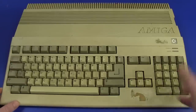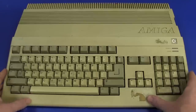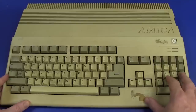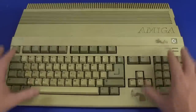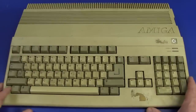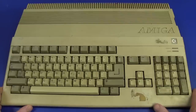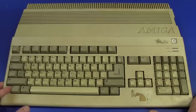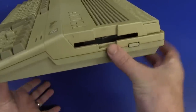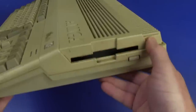Many millions of these sold — 512k of RAM, which was pretty huge back then. This is almost a follow-up to the Commodore 64, although there was an Amiga 1000 a couple of years before this. But that was a big box type, whereas this all-in-one keyboard unit is very reminiscent of the Commodore 64, so it is a bit of a successor in that respect. 68000 processor — very common back in those days — just a shade over 7 MHz, and of course it came in PAL and NTSC standards. This one from Australia is going to be PAL.